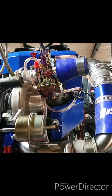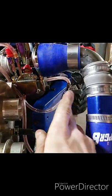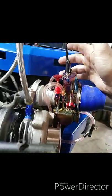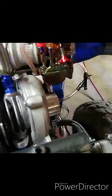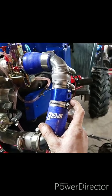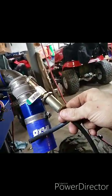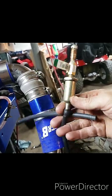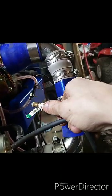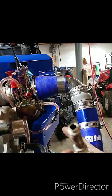My theory after having this carb apart and trying to understand it better is that I'm going to pressurize these — this one as well as this one on top — the two upper ones. I'm going to pressurize these with the boost charge pipe out of this one-eighth outlet, which was the boost gauge port. The only thing I could find was this fuel filter with this one-eighth outlet into this extremely small pipe, which I'm going to plumb to here, hoping that when it creates boost it'll keep the float from doing whatever it's been doing.